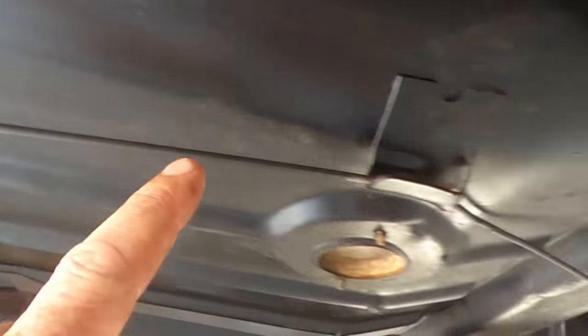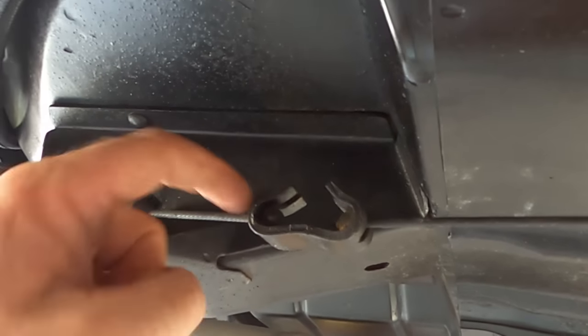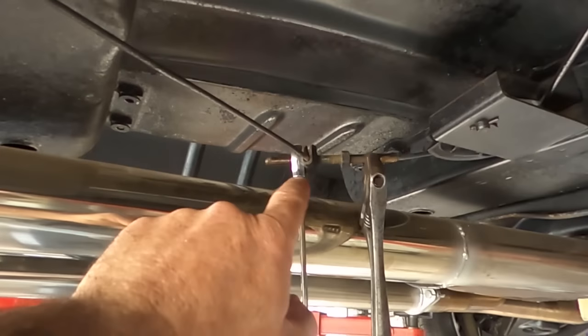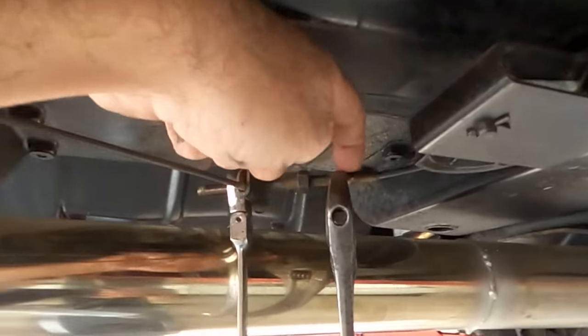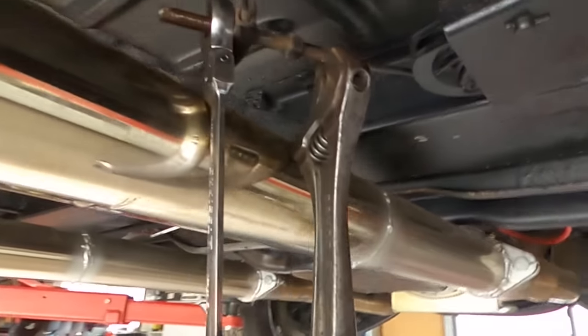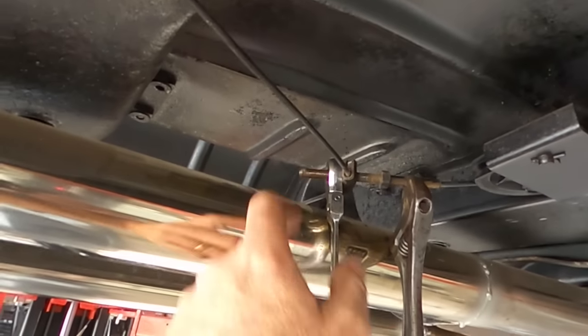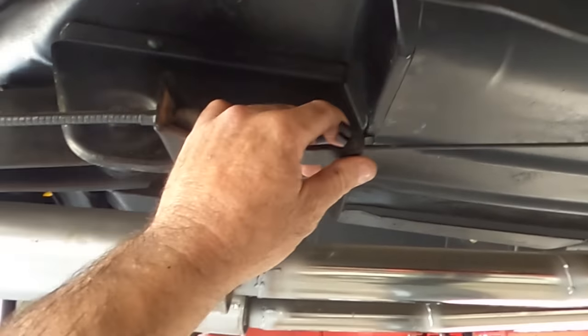So if you follow your cable along, how they come apart is you just get some slack in the line and pop that little ball out through that groove. So follow your line up to the front there. There'll be a nut there, and a flat section. Generally back there is square or flat, and you can just get a shifter on it. And then you just hold the shifter and ratchet the bolt out. You're going to see I've adjusted that. And up here now, that'll give me enough slack that I can pull down on that.